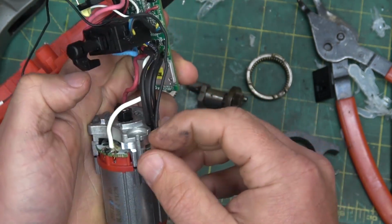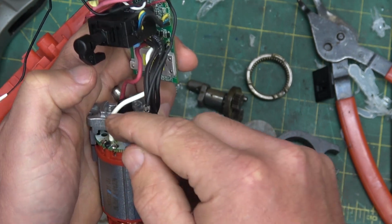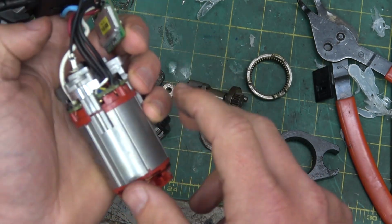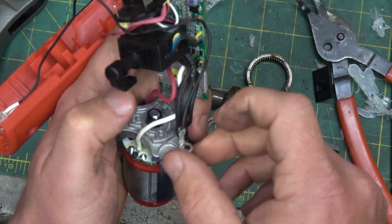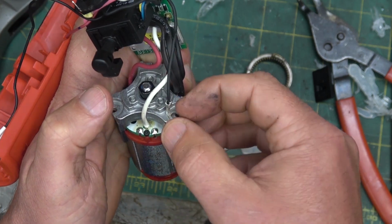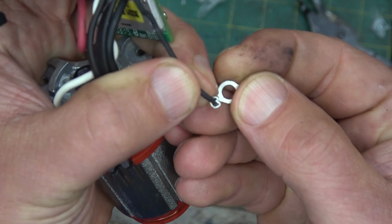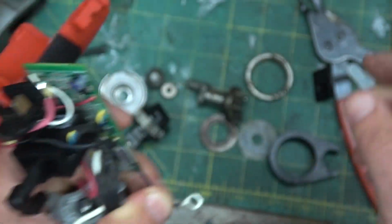Grounds the case, probably eliminates any kind of hysteresis inside, or not, eddy currents inside this casement of the bearing housing here for that high frequency. These things are switching real quick, switching polarity, magnetic polarity, which changes the electric polarity. You get weird stuff happening here, so they ground it out. But the thing is, it's too big. They got to specify a smaller one of these. Look, it doesn't fill the hole, and it just about comes over the top of the fastener.